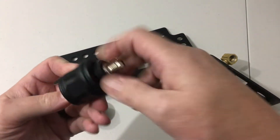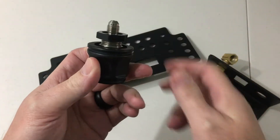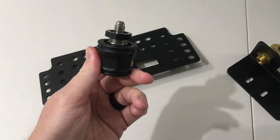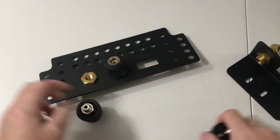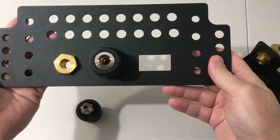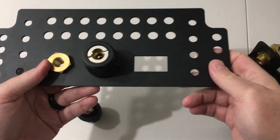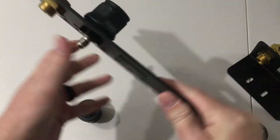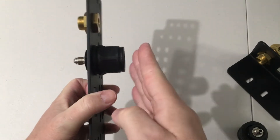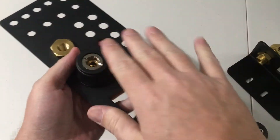This is the one that actually has the threaded nut on the back of it. Everything that I've been designing with these three-quarter inch holes works best with this JIC ARB air coupler, because it makes it very flush. Especially with this piece — this is the under-seat air chuck and rocker switch holder that goes underneath the seat on the Jeep Gladiator. Having this JIC fitting gives a whole lot less space taken up underneath the seat, especially with the seat coming down on it.